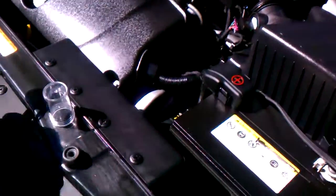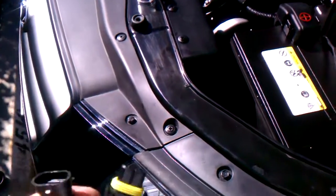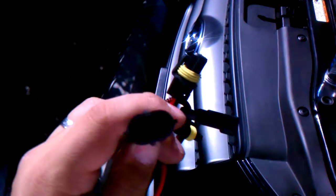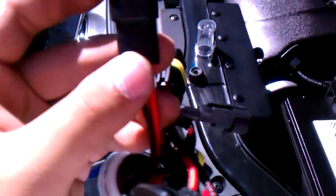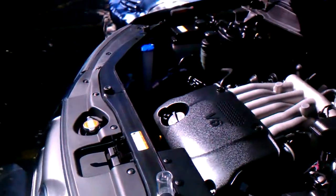This is the H11 bulb. What you're going to have to do is, to get to the prong, you're going to have to take it out of this — you can see the prongs are in here. You just get a little flathead and push it down or push it out, so it can connect to the connector I showed you, that yellow piece.